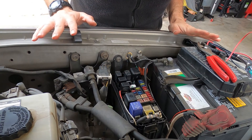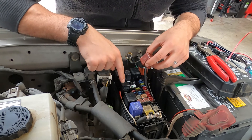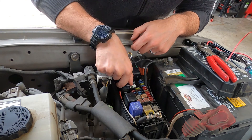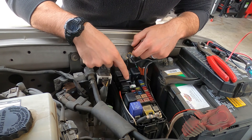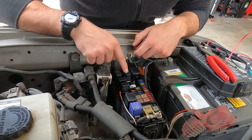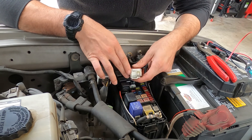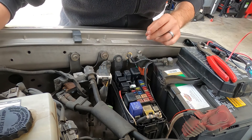Let's go check the relay. When you're testing for relay operation, all you're going to be doing is swapping the relay in question for a known good relay. So if this is a four pin relay for the headlight circuit, I would pull this relay, pull the relay next to it if it's the same four pin style, and pop it in to test my circuit with a known good relay. By swapping relays, you can see if the problem persists or if the problem is fixed — if it's fixed, we know that we have a bad relay. In this vehicle this relay is very specific and I don't actually have another relay to swap it with, and nothing in this box is similar. So what I can do is just a quick power check.